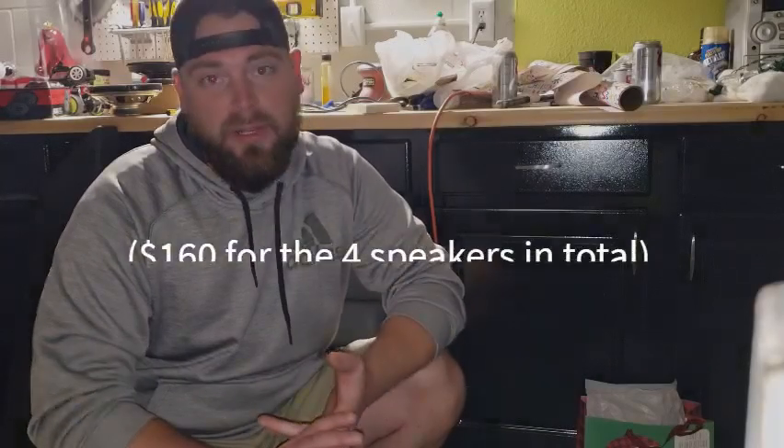So nothing fancy — just upgrading OEM. What I did today is I went out and got a set of four 6x8 Kicker door speakers, the exact same ones that come from Stage Three Performance. If you go to the website it's about $200 for the four speakers and it also comes with a wiring harness which is basically plug-and-play. These ones, however, are not plug-and-play — they're just your standard door speakers, so I'll have to do some butt connectors and crimp them on, solder if I have time.